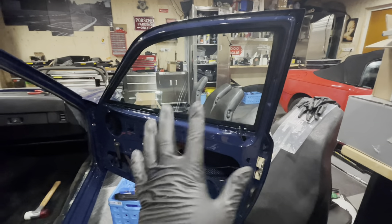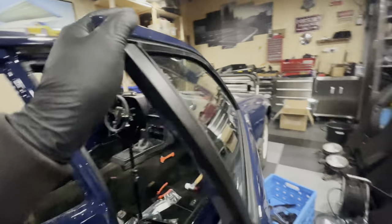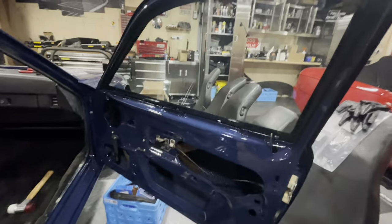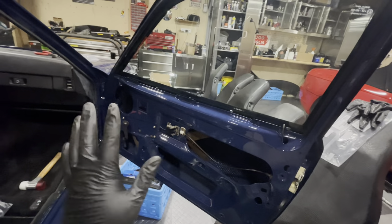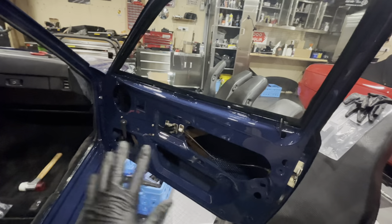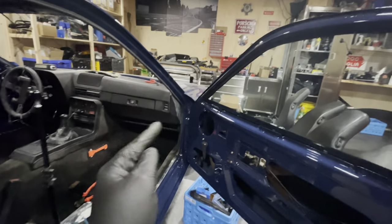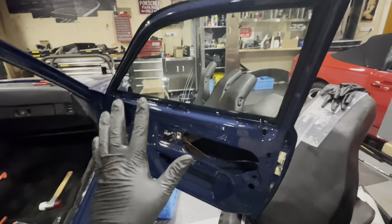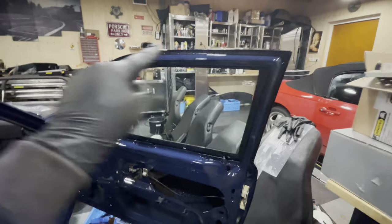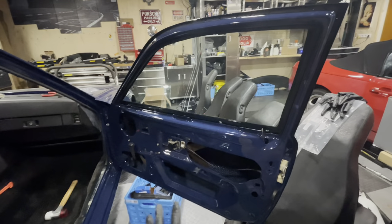That's a bit of a result — I'm really happy with this. You can see that the window on the outside looks really good, nicely seated, everything is working as I was hoping. I can now confirm that you can use the S2 rubbers — it works perfectly and the window slides really nicely with no issues whatsoever. I'm not going to install the door card or vapor barrier yet, because I want to save the cosmetic work for one go and keep the mechanicals open in case I need to adjust things.